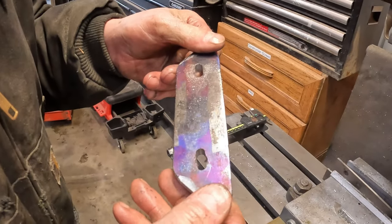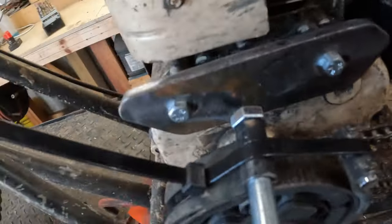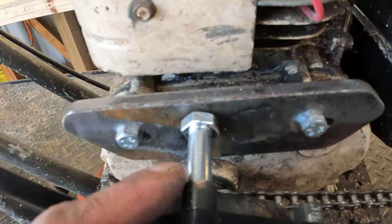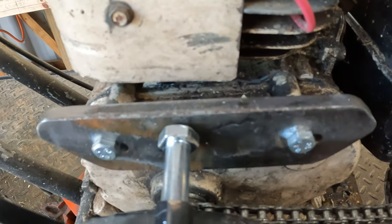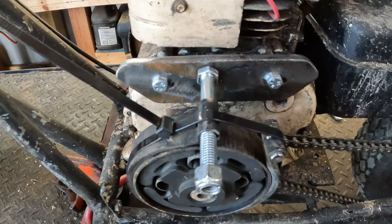And there's how you improperly cut a notch slot. But it's done. Let's go put it on the bike. Bracket's built, with a little spacer — you can see how it's going to be bolted in there. Now we just need to figure out where to drill this particular hole. This will be a through hole on the steel bracket — I'll take the head off this bolt, pass it all the way through, and plug weld it on the back side and surface weld it out here. So let's go ahead and mark this up and start drilling another hole.